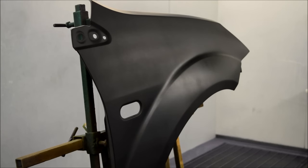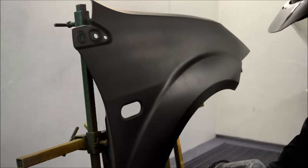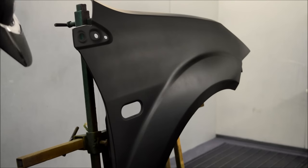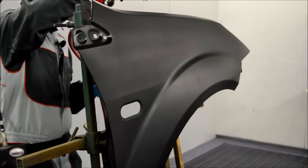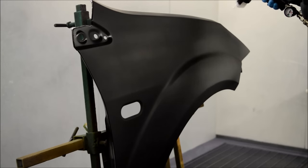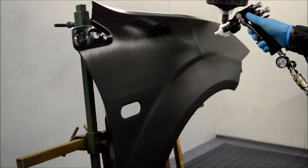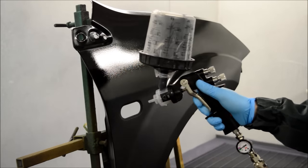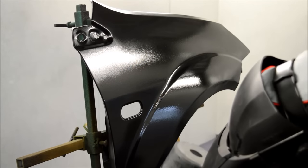Let's go ahead and put our second coat on the panel. We've left it to flash off for around 10 minutes and I'm just going to do the edges again followed by the face. Again, just like I said earlier, I'm taking my time with it. I'm using the black 2K high build primer from UPOL just because it was some I had lying around. One thing I have noticed — try and, when you're using this, slowly work down your panel with your overlaps; don't try and go too quick. You can really see it on there now — it's quite peely, which is not what I'm wanting, but we can always sand it down afterwards. This gun setup is 2 bar spraying pressure; I've got the fan all the way out along with the fluid needle all the way out as well.